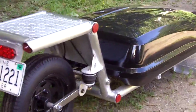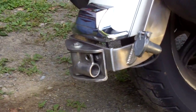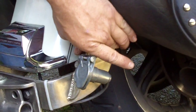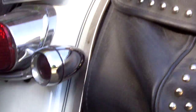Next, you have what I call an easy load hitch that I built. This is a Harley Davidson soft tail heritage. This mount connects all the way into the back — it's a full two and three quarter inch. It wraps around the bike and back up the other side, and connects underneath the saddlebags.